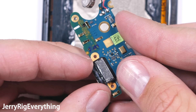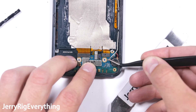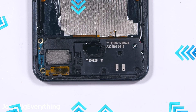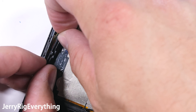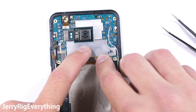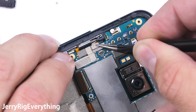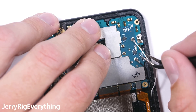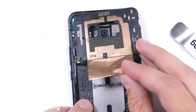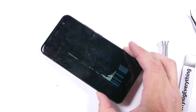Getting the phone back together is easy enough. I'll stick that rubber washer around the USB-C port and tuck it down into the frame, making sure no connectors are stuck underneath the board. After getting the 4 ribbon cables attached to the top of the board and one white wire cable snapped in, I'll toss on the loudspeaker, the top right screw, and the little plastic shield can go over the top of the whole component — there are 7 screws that hold it all in place. The flex sensor on the side rail goes in next with its little plastic guard. The motherboard gets tucked down top-first into the metal frame, and then all the little Lego-like connections along the bottom get clicked in. The screen, extension ribbon, and pressure sensors on the side rails, along with the white and black wire cables on the right side, are reconnected. There are little metal guiding clips that help line the cables into the right spot. One more screw at the bottom of the motherboard, and lastly the battery gets plopped back into place and plugged in. The plastic shield goes over the top of the motherboard with its 5 screws. After a test run — it's as good as new.